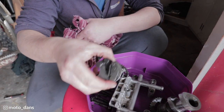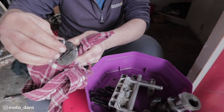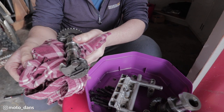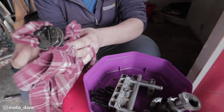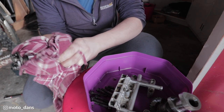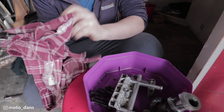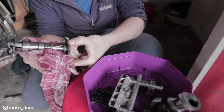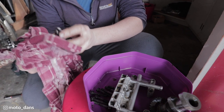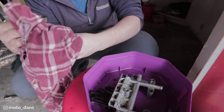This is my exhaust camshaft here, this is the ACR part - the automatic compression release - and basically all we need to do is press this off of this shaft and turn it around 3mm. I may or may not record this as I will have to press it off at my work. I'll give this cam a wee clean up and have a look at all my surfaces - everything looks pretty damn new. Who knows, I may already have the ACR mod done. I'll come back to you when the ACR mod is done.